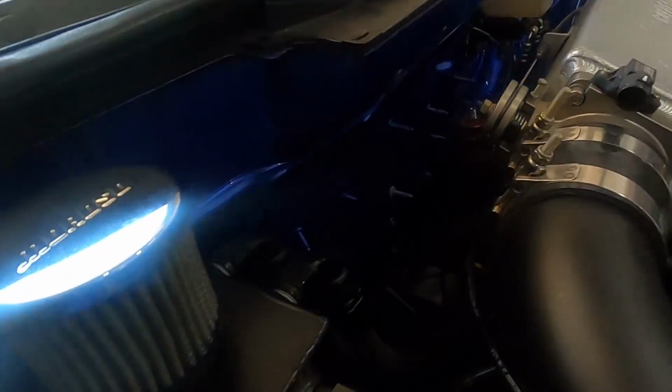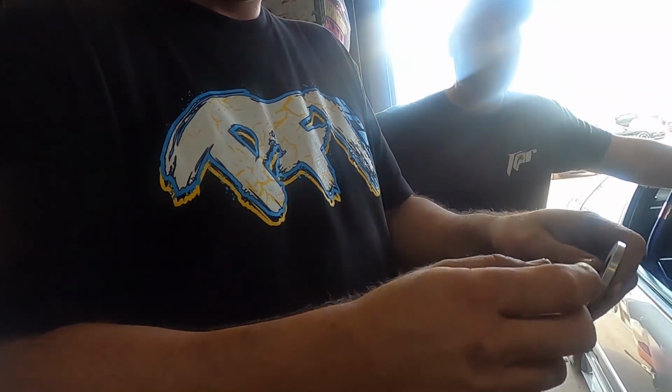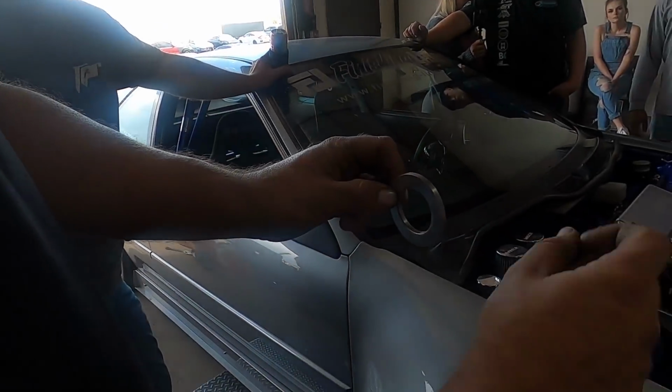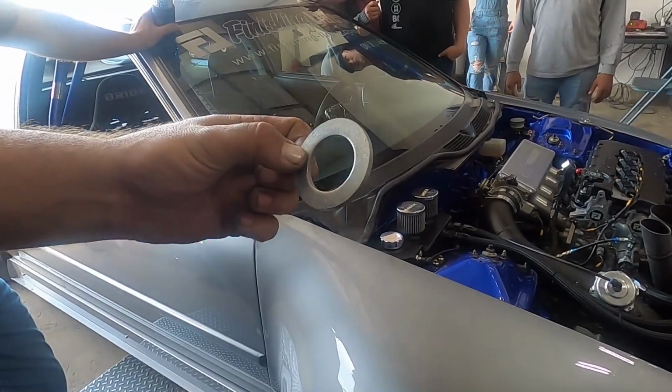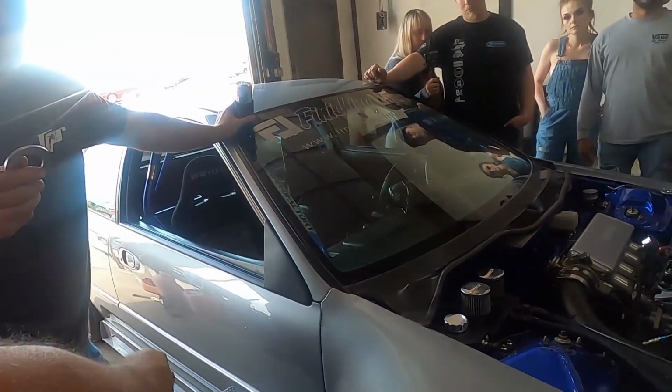With pulling logs now. Alright. So we had an axle kick out. There's that orange flashlight. This is the same problem I had in Houston. When we were in Florida, I had a machine shop cut two of these for me. It only took one to make mine right. So this goes on the outside of the axle so it spaces it out from the hub, spaces it in towards the transmission. Just because they made the axles a little short? Just a touch short. So that's all you need. That's what's kicking us out of gear.